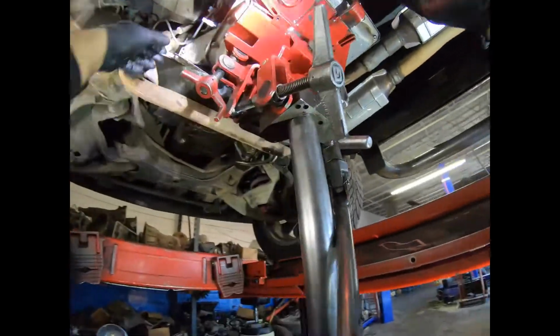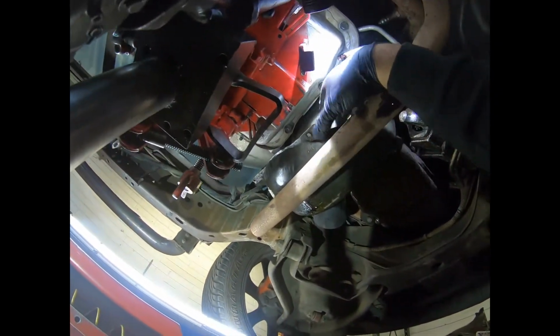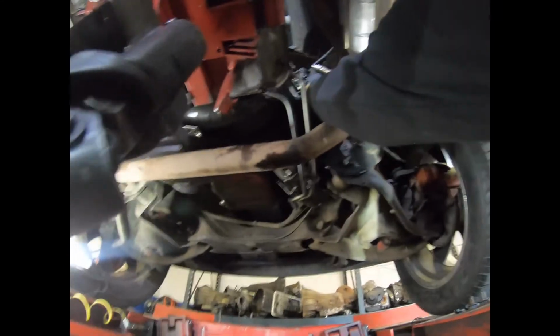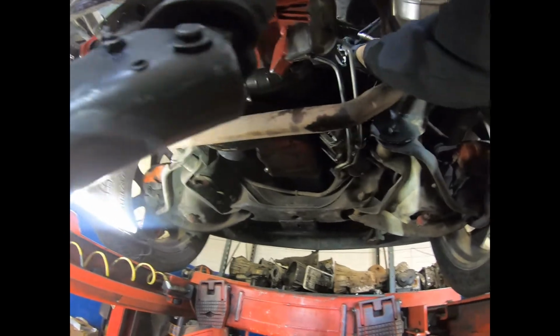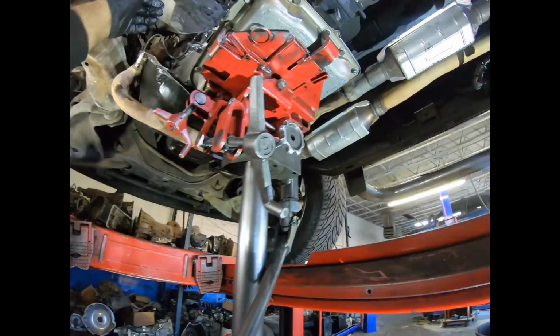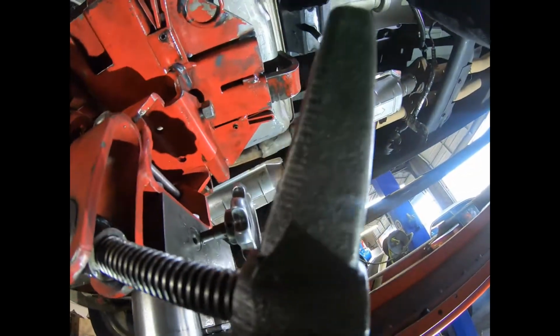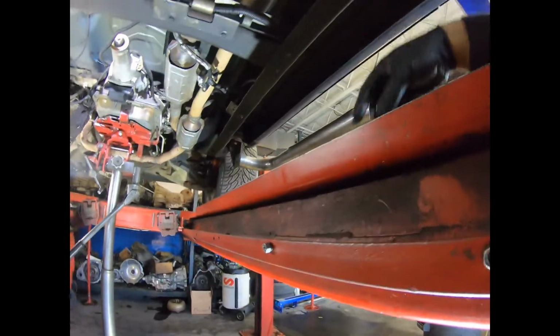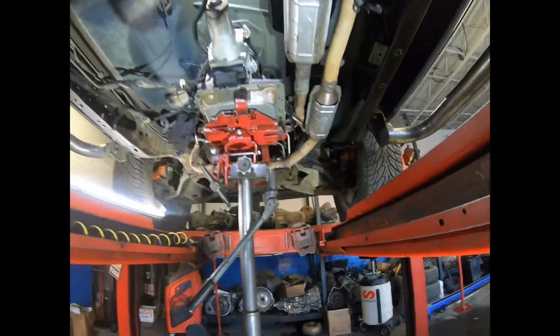After you do the torque converter, you want the torque converter to move. You see? Okay, it moves. It freely moves, so that means that's good. That's a good thing. So now we're gonna put the bracket that goes on the side, and also the bracket that's way up top for the fuel line. And we're gonna use our 13 millimeter nuts. We're gonna put them in.